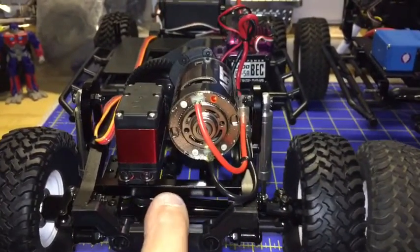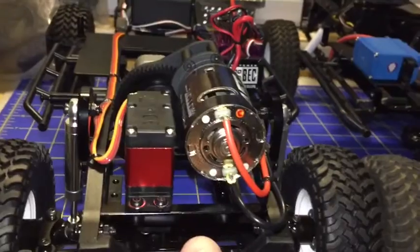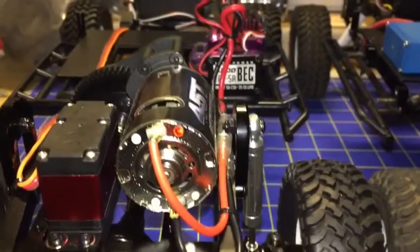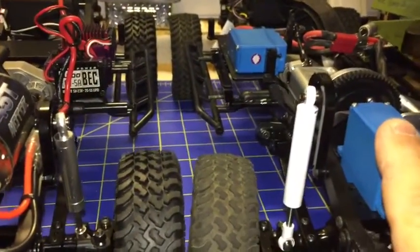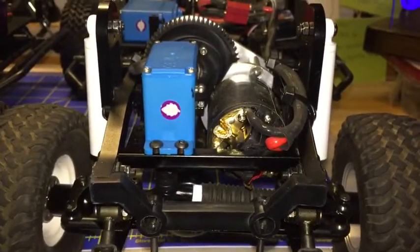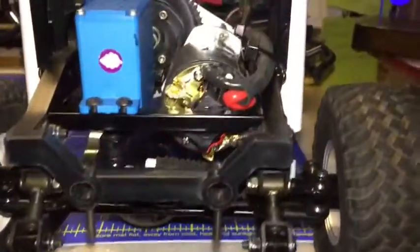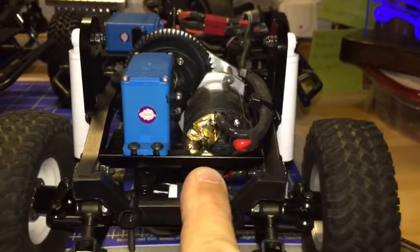This right here is a ready-to-run Trail Finder bone stock. I've had it since February and I have done nothing with it yet — it's just been sitting, never seen a battery, nothing. I've got a shopping cart full of parts behind me that are going to go into this thing. The first thing I wanted to do was drop the motor like I did in my kit. This is my RC four-wheel drive Trail Finder 2 kit, and you can see the difference in the motor height — how much lower that is versus this. It doesn't have any intrusions, everything clears, it just brings the weight of the can down. And as everybody knows, it has one of these — they roll over a lot more than what most videos show.